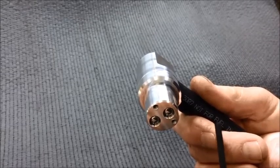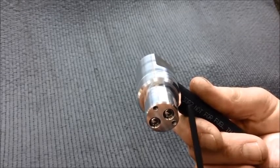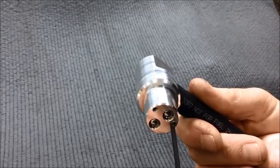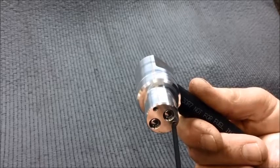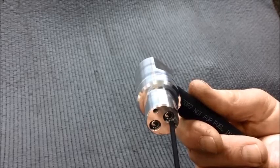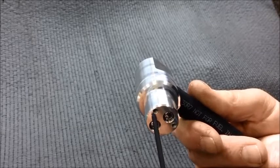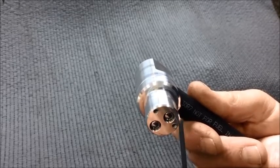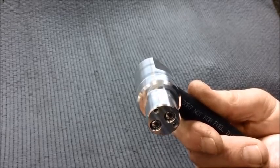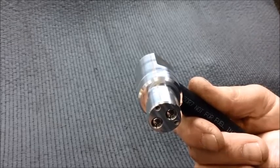And if you follow the vacuum line that would go to the PCV port on the carburetor, and see where it comes into the valve, you'll see there's a tapped hole on the bottom surface of the valve. The check ball that's directly adjacent to this tapped hole, the one that has the tapped hole really close to it, is the cruise circuit of the valve. The other check ball, which has a tapped hole a little bit farther away from it, on the opposite side from the vacuum line coming in, is the idle circuit of the valve. We'll show you in the next two segments how to verify that each of these balls is working correctly.